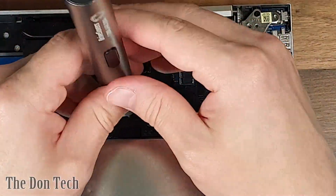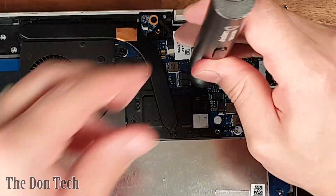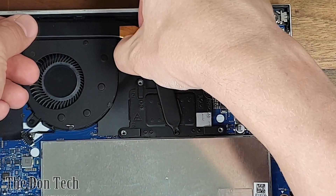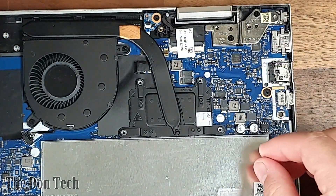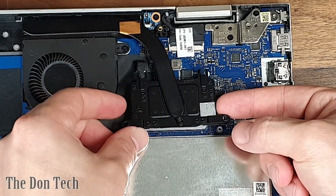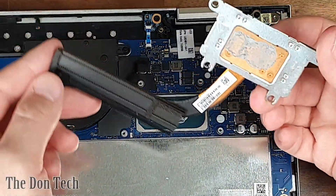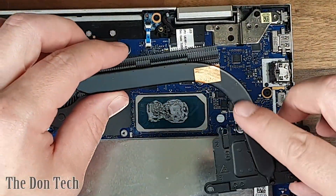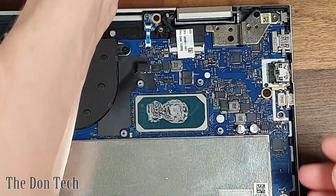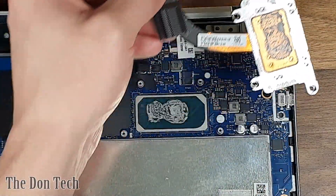So you'll take them off one, two, three, four, and then you'll put them back on one, two, three, four. With all four of those screws out, you want to make sure you're carefully figuring out how the heat sink comes off. This one should not require the fan shroud to come out — and it does not. So I just use my fingernails and lift it up at the bottom here. You want to be very careful not to bend this copper heat sink. Any sort of dents or dings inside here will prevent the gas from going through it, and it will no longer effectively cool. That is a concern with this particular computer right now, that the heat sink is damaged, but the temperatures are okay when it is idle.